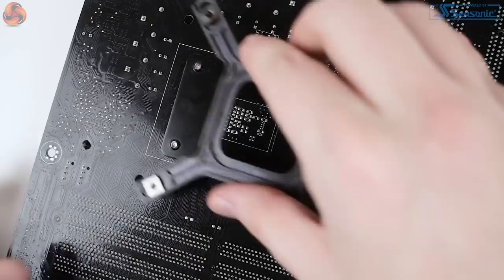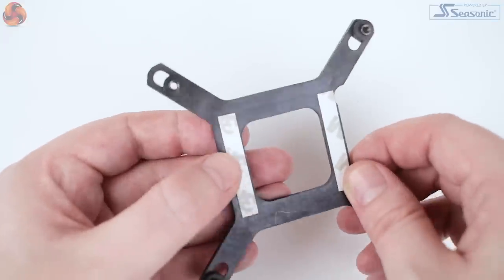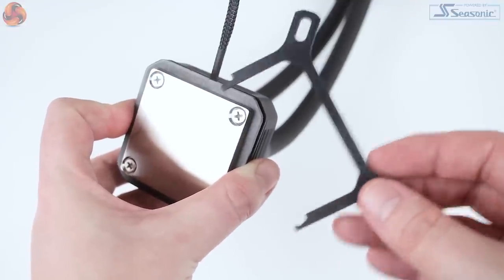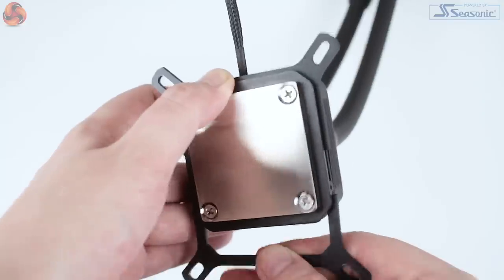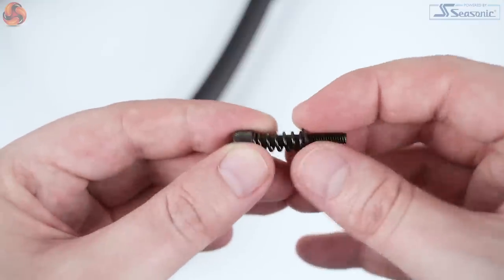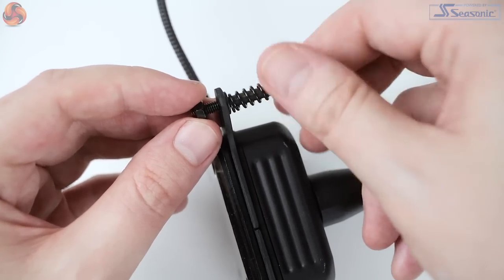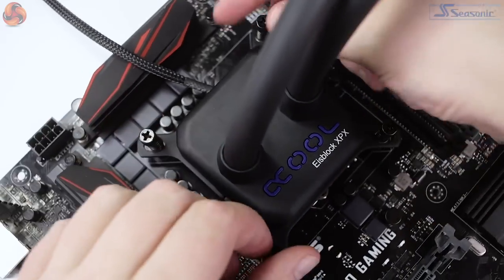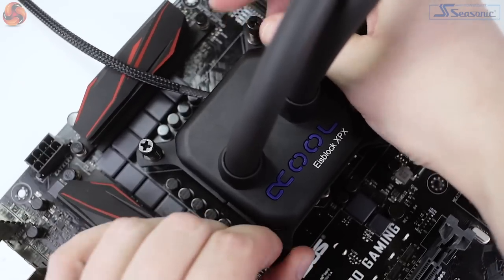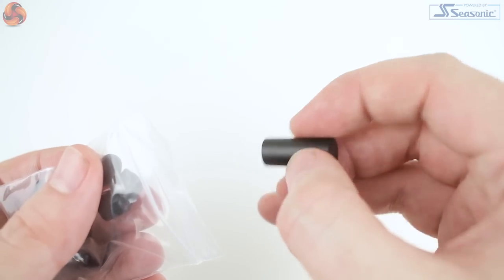So now that we've taken a look at the kit, it's on to installation. Here it's definitely worth consulting the manual. Starting with the back plate, this is probably the simplest stage of the process. All you need to do is fit it to the rear of your motherboard and there are actually a couple of small adhesive tabs to hold it in place. To set up the block, you start by attaching the two piece top mounting bracket. Both these parts slide onto the block following a couple of grooves and click into place. To set up the mounting screws, you first take one of the included long screws and slide on first one of the springs and then second a washer. This whole assembly can then be passed through the mounting bracket and held in place with one of the included nuts. You essentially do need to repeat this process four times, once for each of the corners. When the CPU block is ready, you can apply your thermal compound and place the block atop your CPU, tightening down those screws. There is an instruction note in the manual insisting no tools are to be used - the mounting screws just need to be tightened down finger tight. There are also a couple of rubber caps provided which can be installed on top of these screws for a slightly cleaner aesthetic.